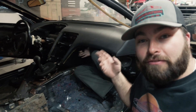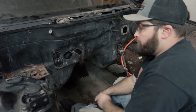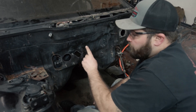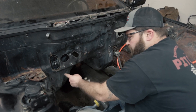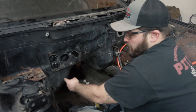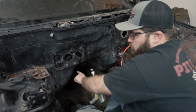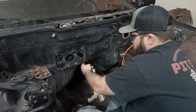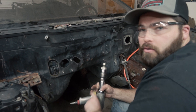You can't officially fit a grown man behind the dash of a 300ZX. Now that we've got everything cleared off the firewall on the inside, we can start modifying the tunnel. We've got a basic line of where the transmission is, and we're going to take our air chisel with a hammer bit and slowly massage all this out — it's a lot cleaner than beating it with a hammer if you've got good trigger control.